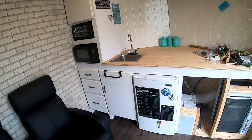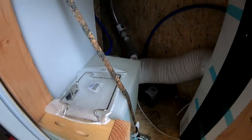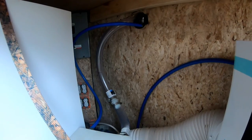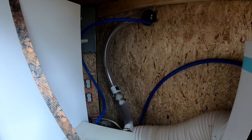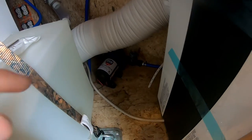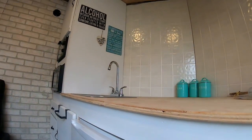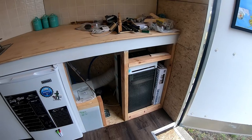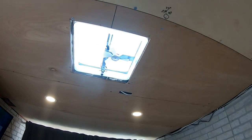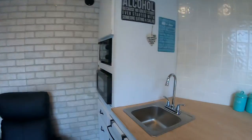The kitchen was built from scratch specifically to meet our needs. We've got a five-gallon water drum here — you can see how it meets the filler neck — and the blue line vents it out. If you overfill it, water just feeds back out of the blue pipe to atmosphere so you never get any leakage inside. The tank is connected to a water pump which comes to the tap. We've got running heating and AC, and a 12-volt fan in the roof that pops up and sucks the hot air out from inside. We've also got dimmable lights up front.